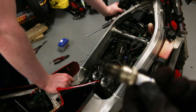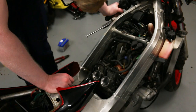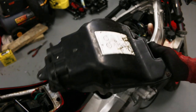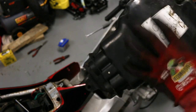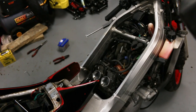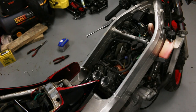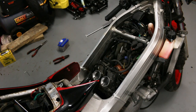The other thing to check is to make sure the airbox is not blocked in some manner. We remove the airbox cover by taking off the bolts — inside should be the air filter. Given how loosely everything else has been done on this bike so far, I'm going with 'should be' rather than 'will be' for the air filter.